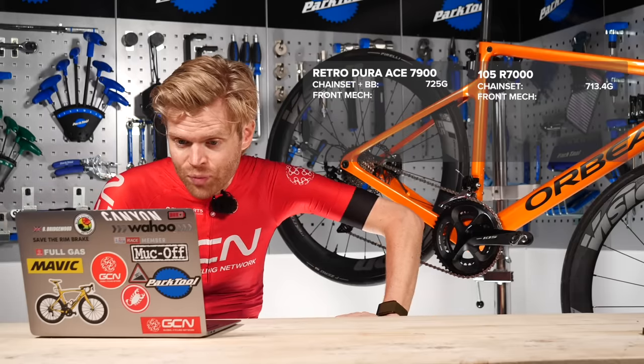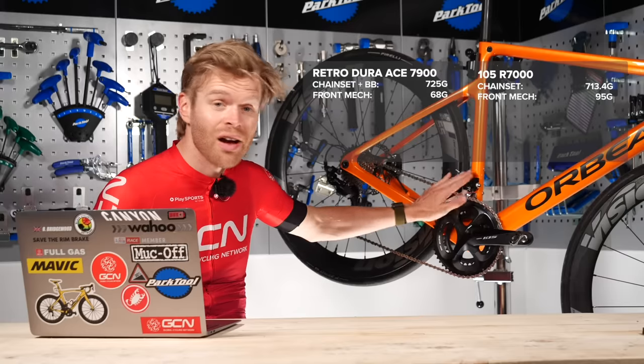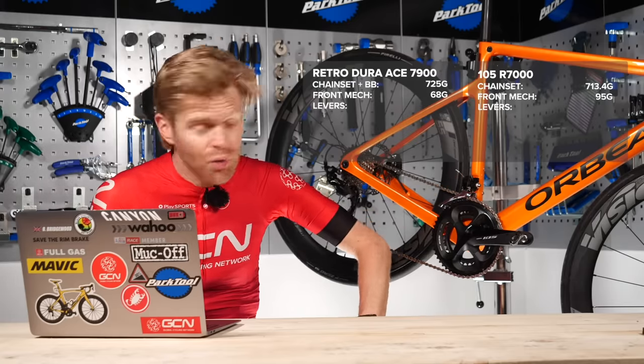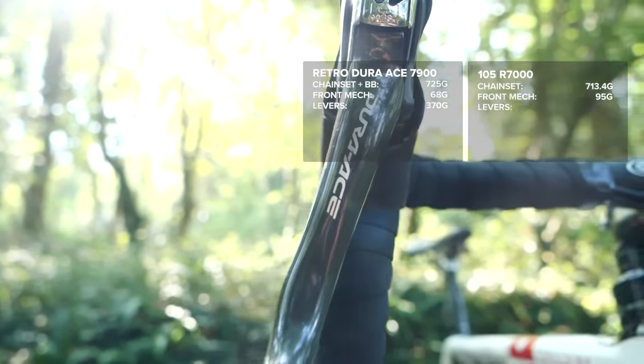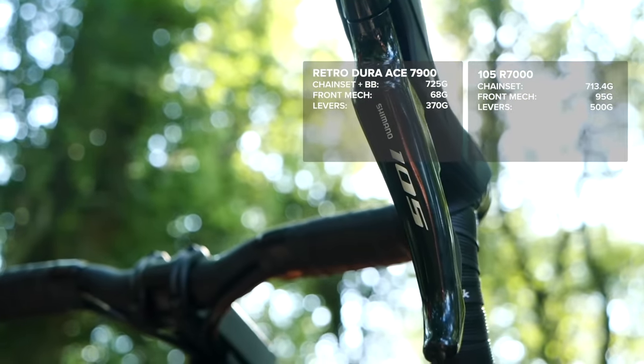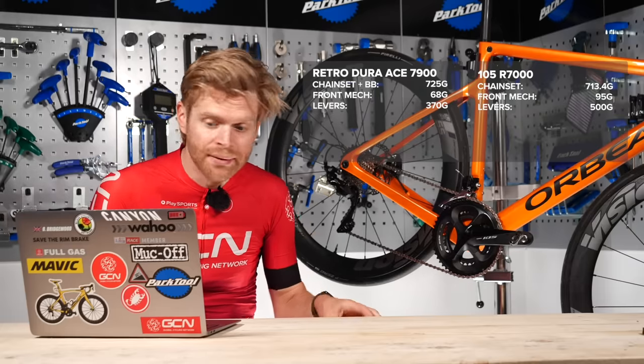The front mech on the Dura-Ace is 68 grams, whereas it's 95 grams on this one, so a little bit heavier. The levers are 370 grams for the Dura-Ace, 500 grams for those 105 levers, but they are hydraulic, so there's a bit more gubbins crammed in there.